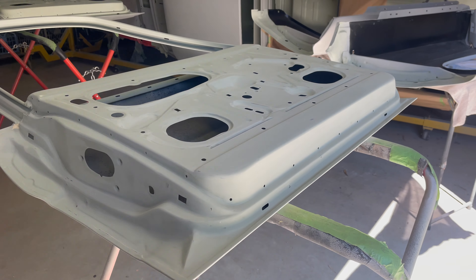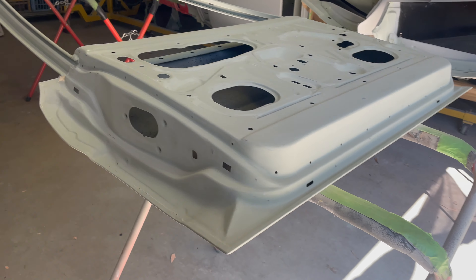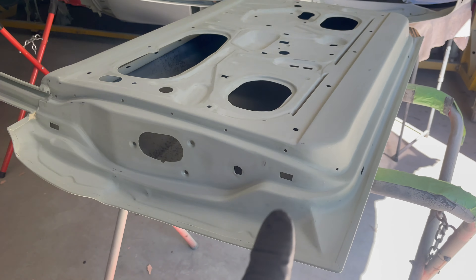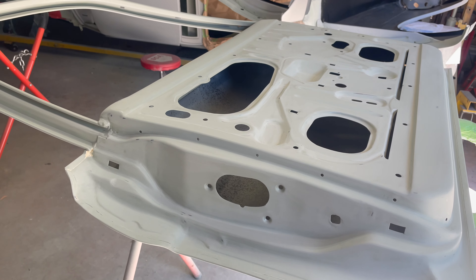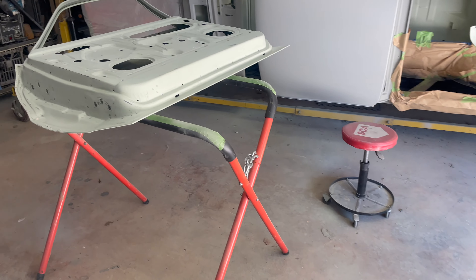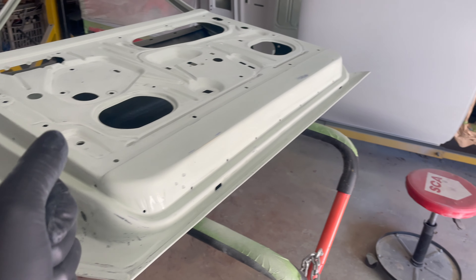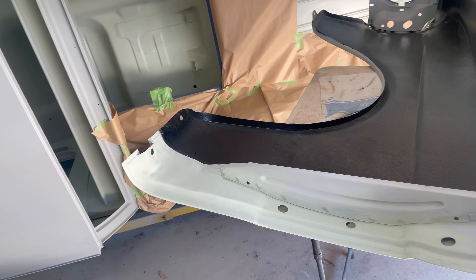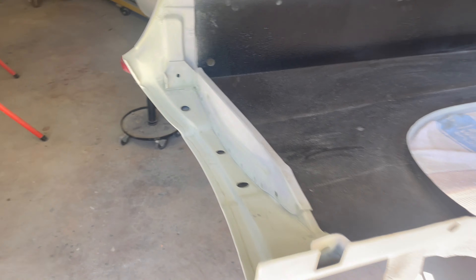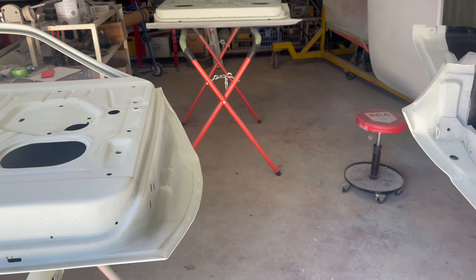I'm about to give it — yes, I know nothing looks any different, but it's been cleaned and checked over, seam sealed and all those little bits and pieces. So it's 100% ready for the final coat of undercoat — I'll give it probably three coats of grey primer, the last coat being right before colour. I'm doing the inside first, probably because it's the best way to do it, but also because I'm still learning how to use that paint and might even use the new gun.